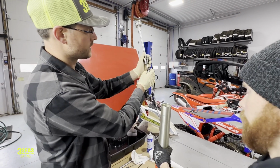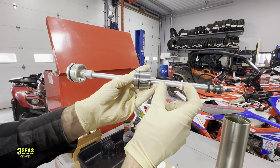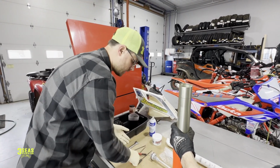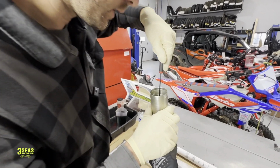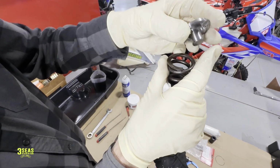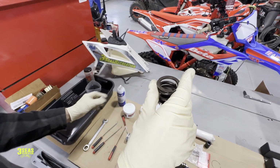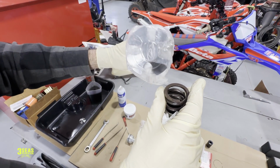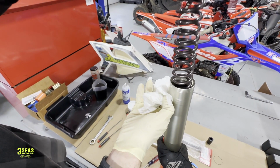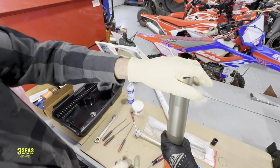So this rod needs to stay up in here. This is what we're going to take out. In a minute, we're taking this white spacer out of here, and we're going to put our black spacer in there. What I'm going to do first though, is down inside of here, I'm going to tip it my way a little bit and show you guys what's coming out. So this is the spring, and this is the old bushing that we're not going to use. How we can tell is the new one has a little Beta logo in the middle of it. So there's the old one. See how it's CNC'd in the end of there? So don't worry, that's my cheat way of knowing. And then this is our long spring that's no longer going to be used. We're going to let this drain over here in the tub. So spring is out. We're done with this portion for now.